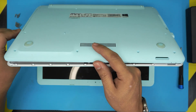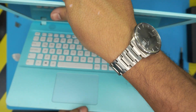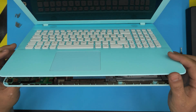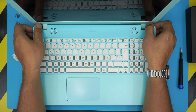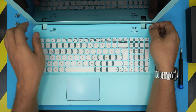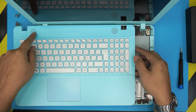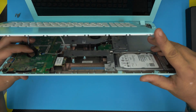Make sure you put your hand underneath so the palm rest doesn't fall down. Now that the palm rest is loosened up, put it in a regular position and lift it up — but don't lift up too much because you don't want to yank the flex cable. Open the screen a little more to give yourself slack. Place your palm so you don't pull it out; just lift the back up about one centimeter and move it towards the left side where the speaker aligns.